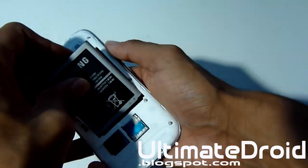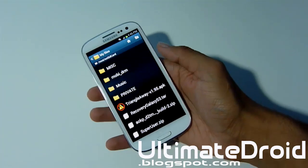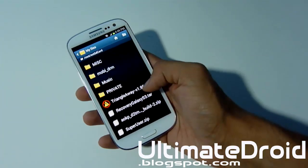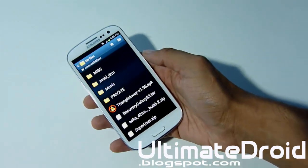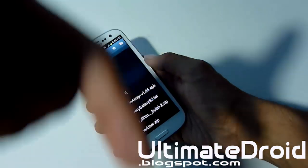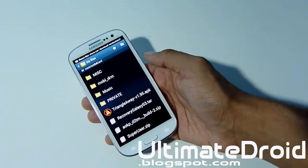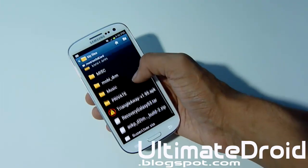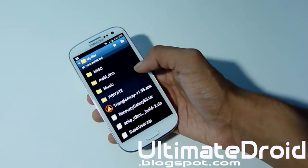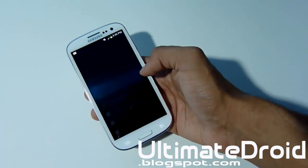So I booted my phone and we'll get started on how to remove the custom binary. My phone is booted up and right there you can see it's called TriangleAway APK. It has an app that you just install. As always, I have a link in the description below on where to download it. All you do is click on the link, download the actual file directly onto your phone. Just download directly onto your phone — it makes life a lot easier. Once you have it on your phone, just locate where it was downloaded and tap on it — we're going to install it.